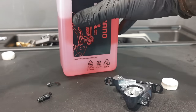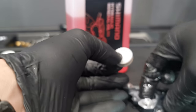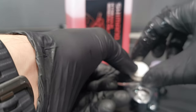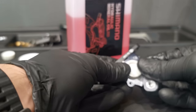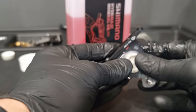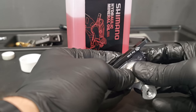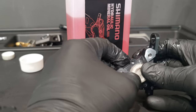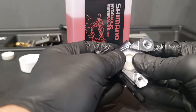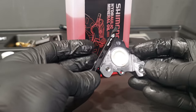So what I'm doing now is smearing my piston — these are actually the new Ultegra brakes. I broke it during bleeding, I've never done it before but I did it this time. Smear it with oil and try to push it very evenly from both sides. It doesn't go into the caliper that easily, and also make sure you do it with the right side — there is an inside and outside side of this piston.